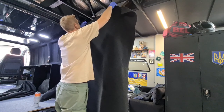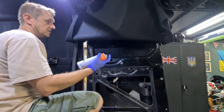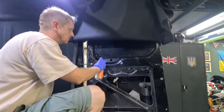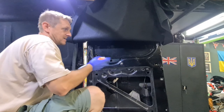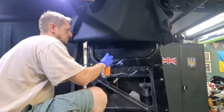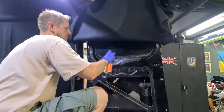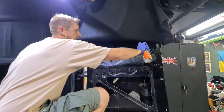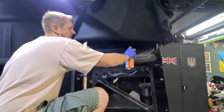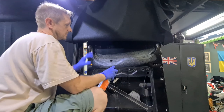Let's get it hooked over. This is just the same as spraying a vehicle — if you're too far away the glue will dry before it lands, if you're too close it'll run. No different to spraying paint. Stand back around 12 inches and you get a good spread. If the glue starts to dry you can just spray some more — if you layer it up you're waiting for the solvents to go off. Try and get your angles symmetrical and straight lines.